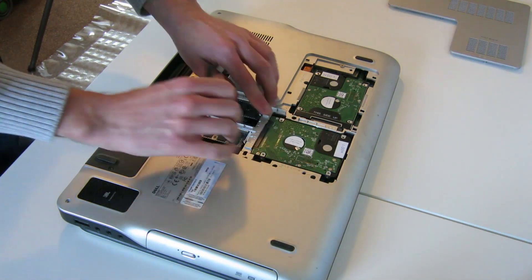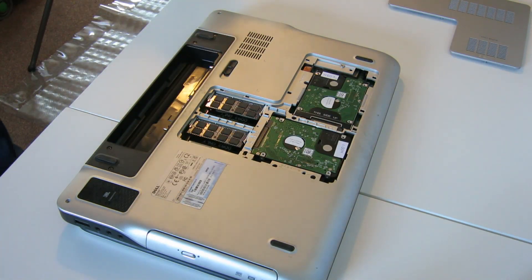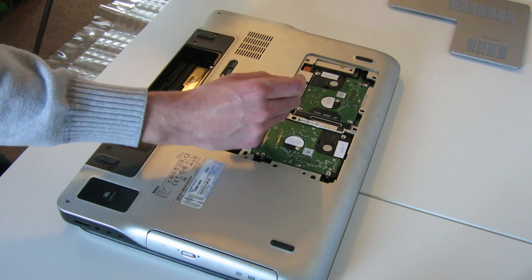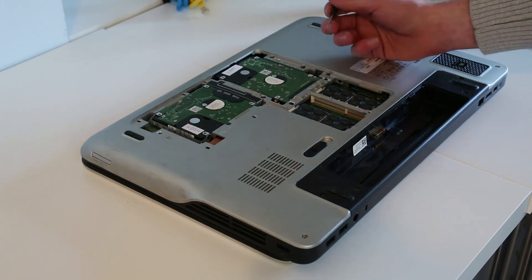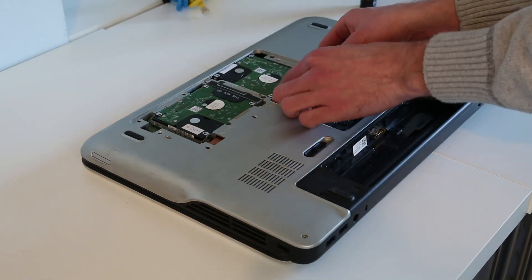The hard drive — hard drive one in here — should have some additional screws holding it in, but as we've been testing a few things on it, they're removed at the moment. I would recommend that you label your hard drives as well. This model has two drives, so label them just so you don't mix them up when putting it back together. The first drive I simply need to slide out.